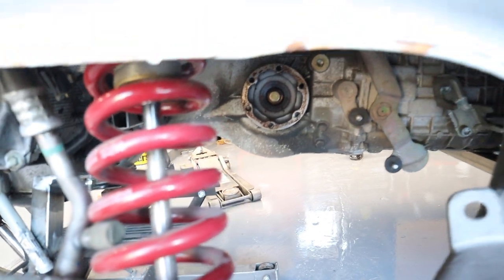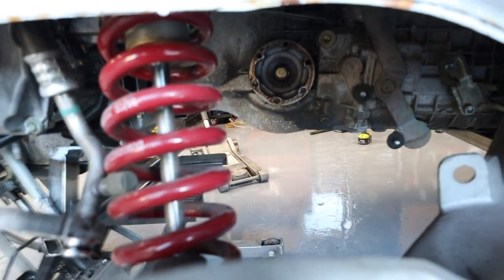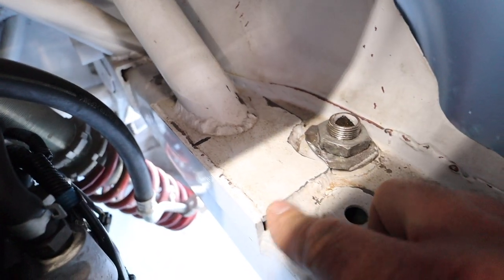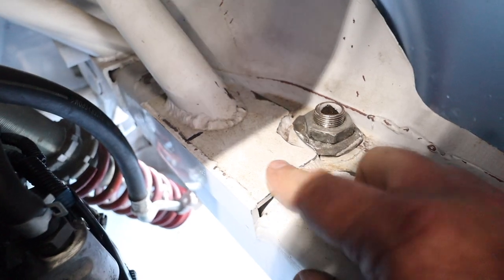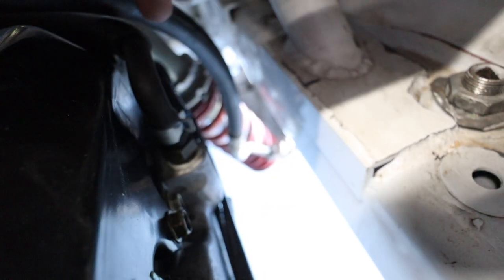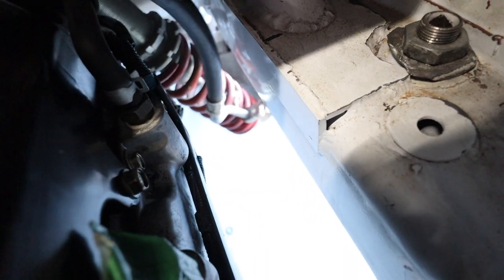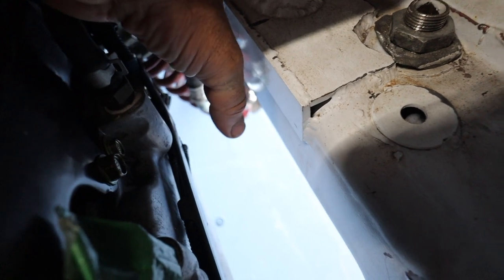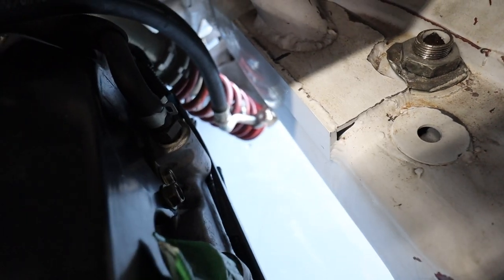Otherwise, I think I've figured that out. This spot here is a reinforcement for the roll cage, and it's almost like a quarter inch chunk of steel. I'll make a couple of ears that come off this way and get welded on from this plate, where I can put a bolt through fore and aft. That's the bolt that will hold the engine where it's going to be.